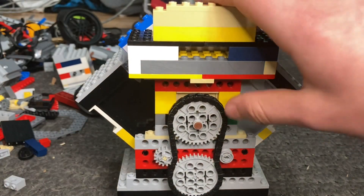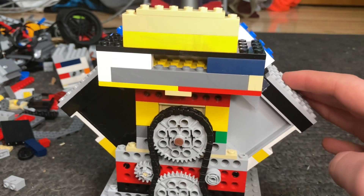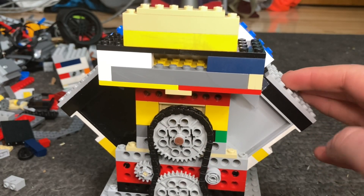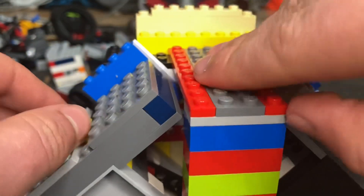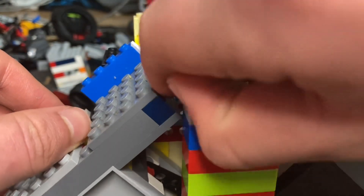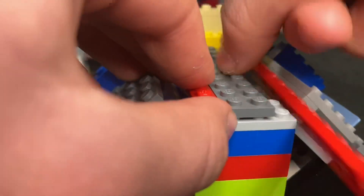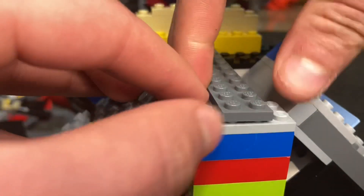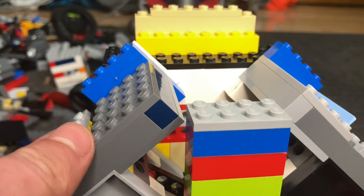It's a lot more efficient because it saves space and also makes your manifold a lot shorter and easier for air distribution, making it in turn run a lot faster. If we take a look on the inside, the reason why I have these four pieces here holding the manifold to the other side of the engine is to hold it in place and create a better seal.